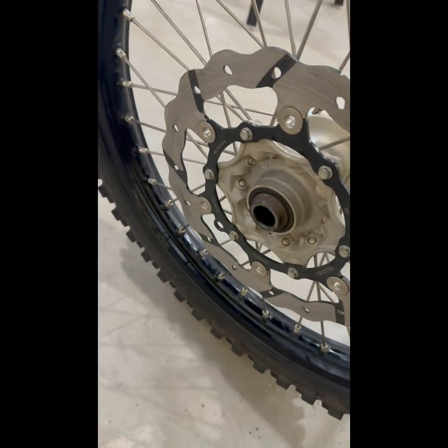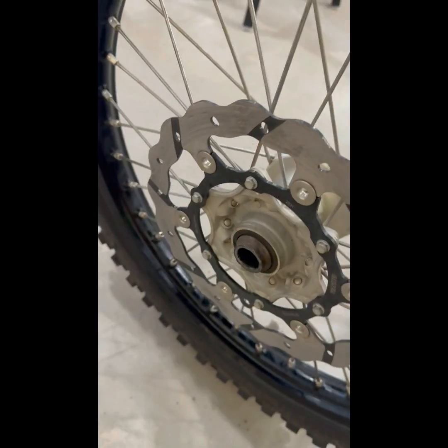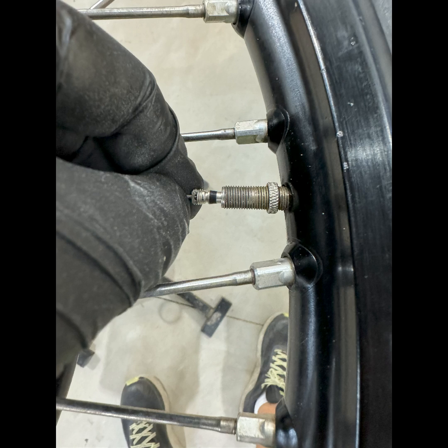Forcibly bounce the tire on the ground and rotate until you have bounced the tire all the way around. This will break the red liner loose anywhere it might be hung up and distribute the soapy water all the way around the red liner. Now reinstall the valve core in the high pressure tube.